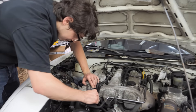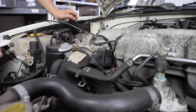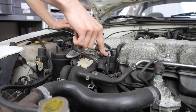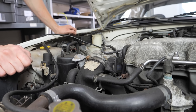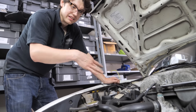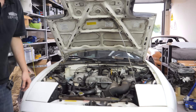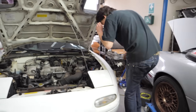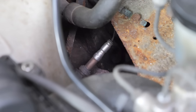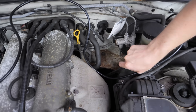This is the standard 1.6 TPS. We change that every time we put a standalone on a 1.6, because it's only an on-off switch — not a proper TPS with a linear zero-to-five volt range. I don't even know where the sensor is on the 1.6. Oh, it's right there.